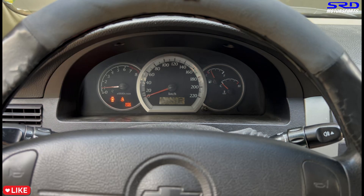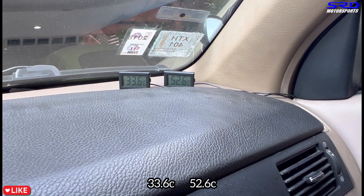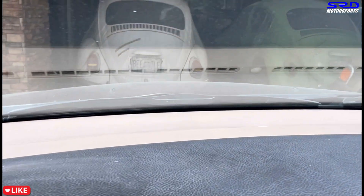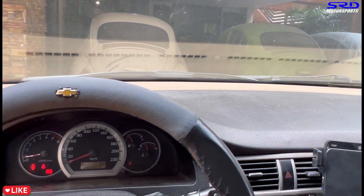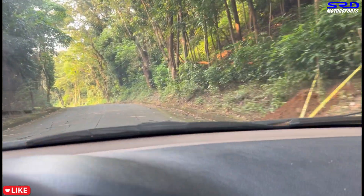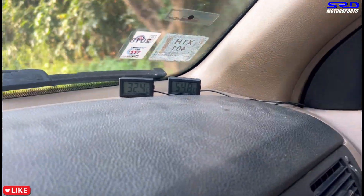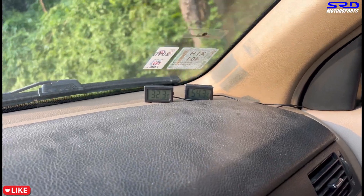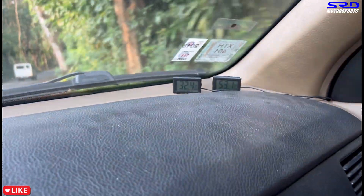Now it's at operating temperature. Look — it's higher: 33.6°C ambient and 52.4°C engine bay, and it keeps going up because the car isn't moving forward, just parked like on the dyno. Let's drive it out. As we start driving, the engine bay reads around 55°C. We're trying to maintain 40 kilometers per hour and the delta difference is still there.